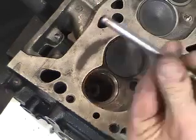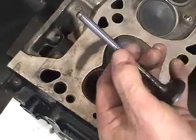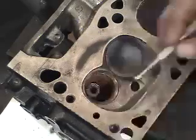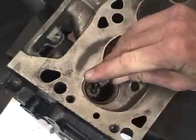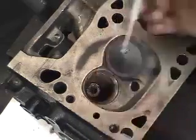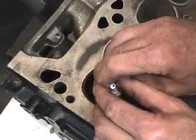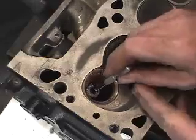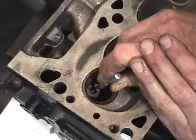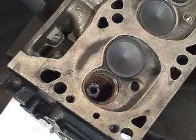Through measurement we've established that our dimension on the valve is 310 and a half thou — 0.3105 inches. Going back in, we select the position, get the average reading, take the small hole gauge out, read it, and re-check in three positions. All three positions have been checked and an average reading is calculated at 312 and a half.